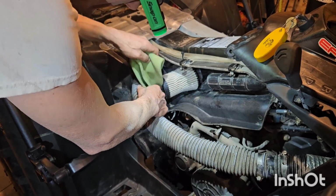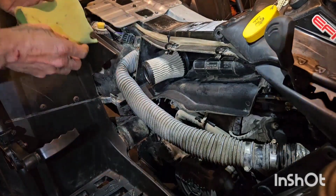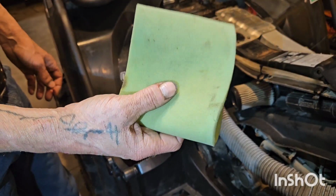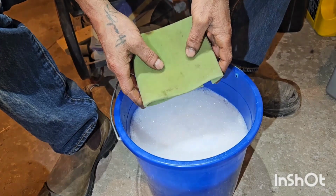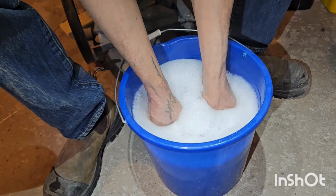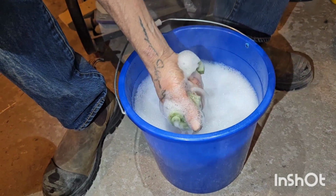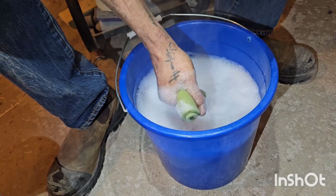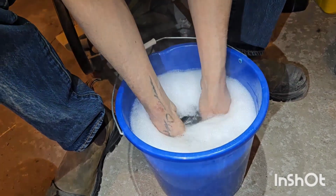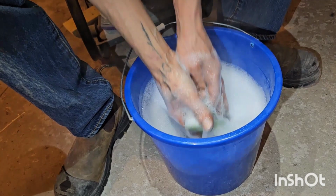Well, that's not bad. We can get another season out of that. We are going to clean the pre-filter, and we're going to show you how to do that. Take some warm soapy water. Ooh, that's really warm. Sorry. Soak that and just take it and squeeze it. Don't wring it. You'll tear it. Just take it like this. Get it good and wet and just squeeze it out.